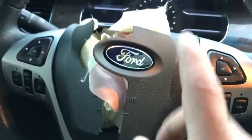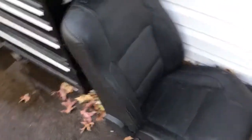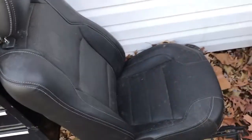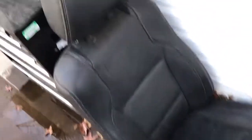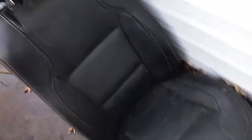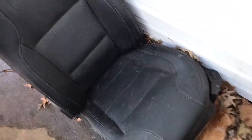As far as repairs inside the car, we're going to have to replace the steering wheel airbag, the curtain airbag, the driver's seat airbag, and the driver's seat belt — four parts that need to be replaced inside the vehicle. When I was looking for the seat airbag it was about $100, but the entire seat was $160. The guy sold me the entire seat and wrote the ticket for about $120.